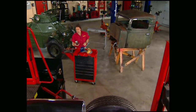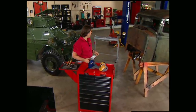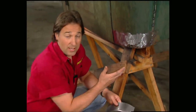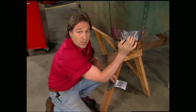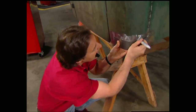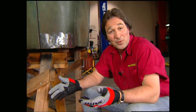Welcome back. A few weeks ago I showed you how to make replacement metal panels for areas on your truck where you're having rust problems. Using the proper tools — like a sheet metal brake and a shrinker-stretcher combination — you can make some killer panels. Now I'll give you tips on how to put them in. First, establish how much metal you're going to cut away. Remember, rust extends beyond the obvious holes, so leave at least an inch so you're into solid metal. Once that's decided, trim your panel, set it in place, and outline it. Then decide what technique you'll use — you have a couple of choices, both with pros and cons.